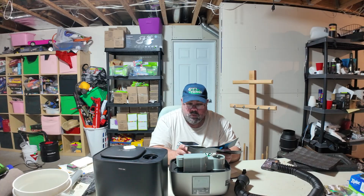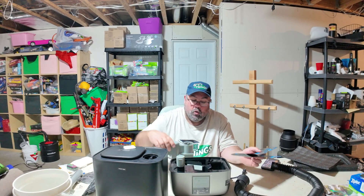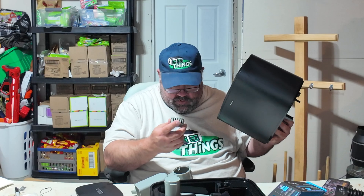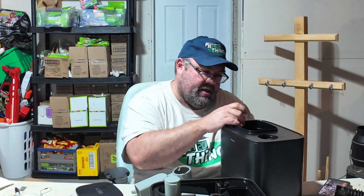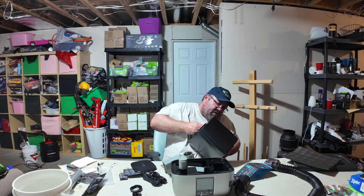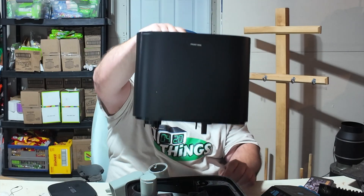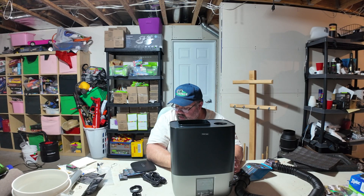Cleaning is pretty easy — you're going to use vinegar and water, that's how you clean almost every humidifier. You'll want to clean the little white nebulizer with that brush as needed — cleaner the better. There's a small foam filter in the cap you'll want to clean every once in a while. In the bottom of the tank there's a water float — when it's sitting flat no water comes out, but once it's placed in the unit it starts bubbling water in.